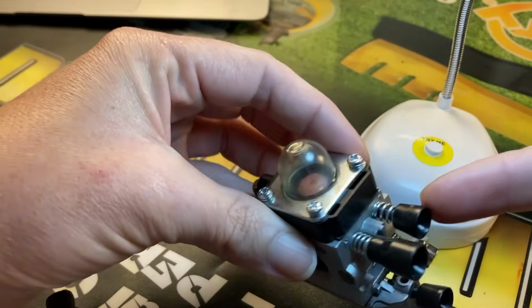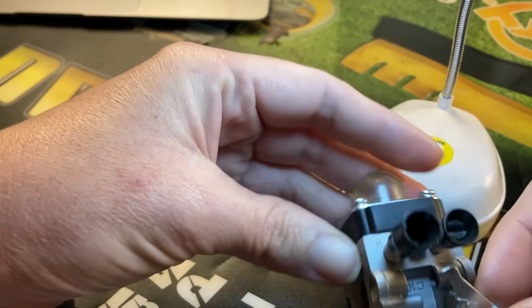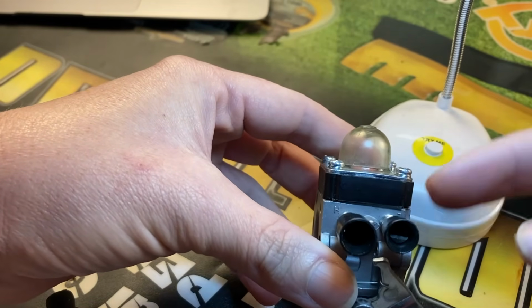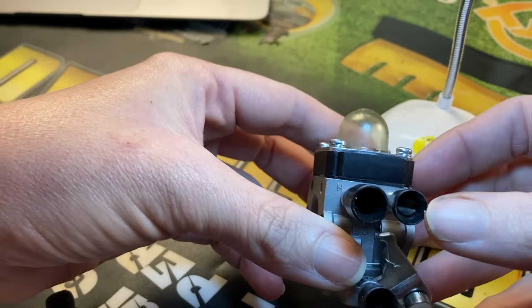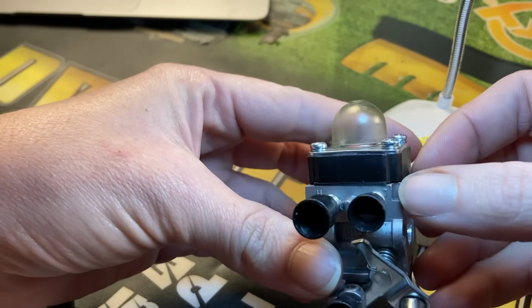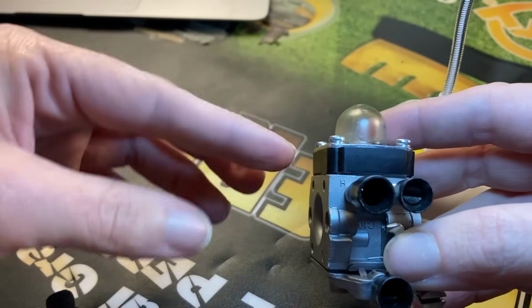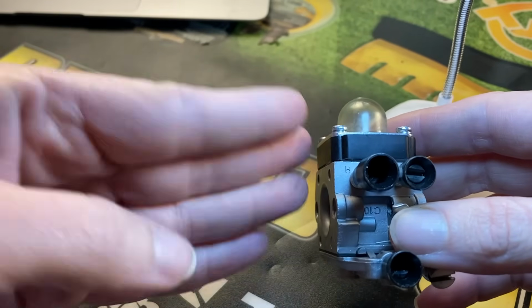They have fake limiter caps on them, so you can just adjust away with a flathead on those and it's not gonna matter. You're gonna wanna find out where your low idle adjust screw is and your high speed screw is, and most of the time you can find that because one has a little L on it and the other has an H. But if you cannot see in that far, the high adjustment is always the farthest away